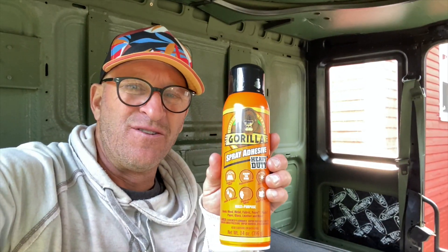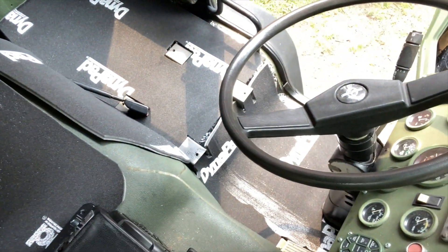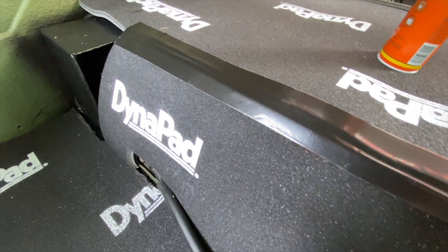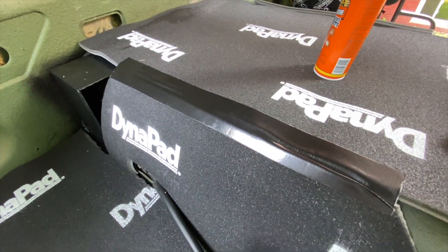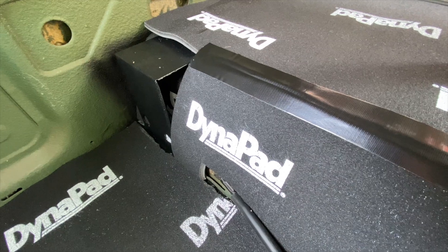I think it's day maybe six working on the truck. I'm working on Dynapad today. I basically got it all cut and laying on the floor, and now I'm going to do a combination of spray glue to keep it from moving when you put your feet on it, and I'm going to tape the seams with some big Gorilla Tape. Let me go to an overhead view — you can kind of see it there, covering the floor inside. You can't probably tell by listening to me talk, but it is significantly quieter — the sound doesn't echo in here. Right there you can see I'm just taping a seam. The reason I'm taping it is largely so it's a smoother transition when we put the carpet over the top — you don't see as much of a seam, and it keeps everything together.